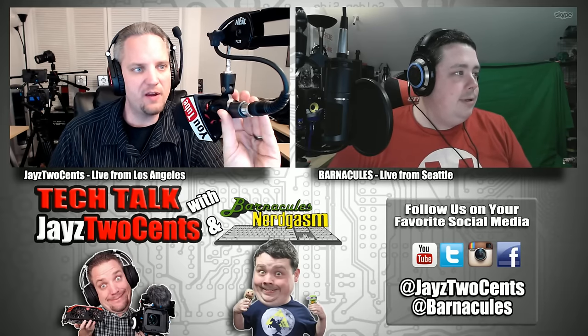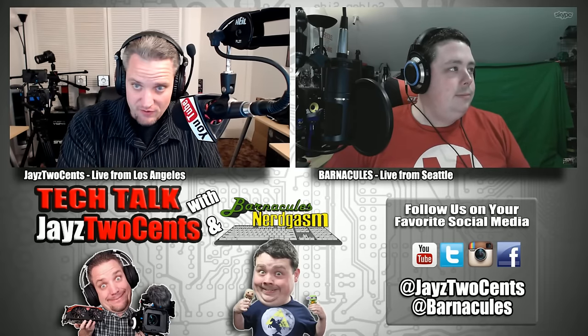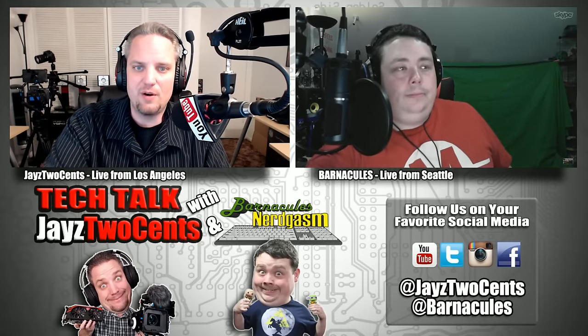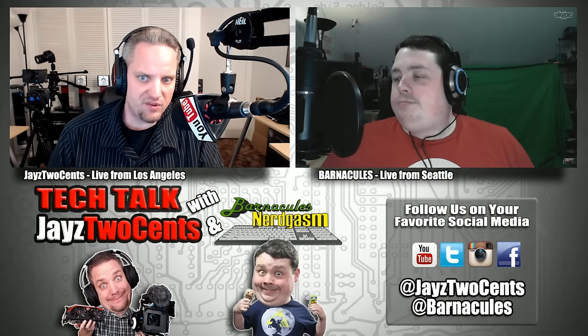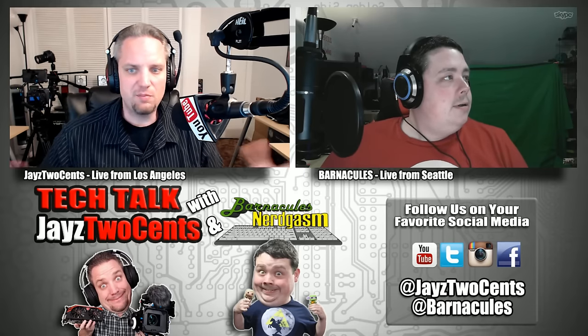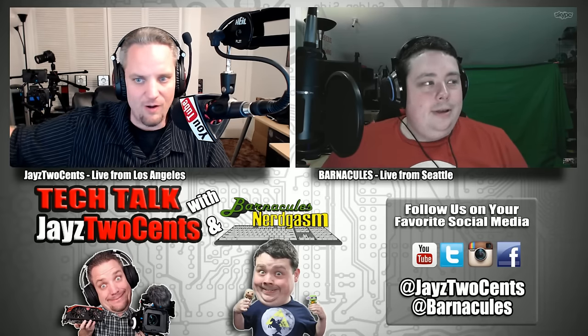As you guys can see I've got the good mic going. Last week I'll go ahead and give Microsoft a small apology — I was blaming Windows 8. But it's partly Windows' fault and partly my fault. Jerry, you remember when you're running your powered mic there sometimes you have to put your mic level down to like five? Okay, I was used to doing that on Windows 7. Windows 8 for some reason does not have the mic boost built in for the USB device, so it demanded that the level go up to like 75 for it to hear me. The problem was it introduced all this massive buzzing.